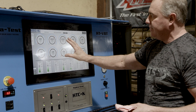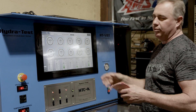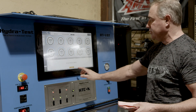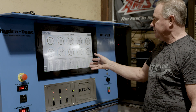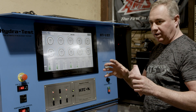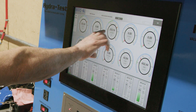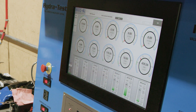We do a lot of homework up front to make sure this is programmed properly with all our high and minimum points set. We're pushing this at 450 PSI right now, which is almost double the pressure this transmission would ever see in service. The max pressure in service is 250 to 270 PSI, but we run them at 450 PSI to make sure that if there's any gasket or seal that's going to fail over time, we push it to failure immediately. Right now in sixth gear locked up, you can see 250 PSI — all these clutch packs are doing really well.